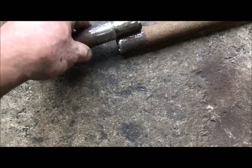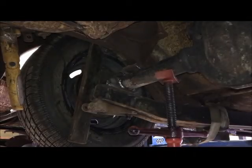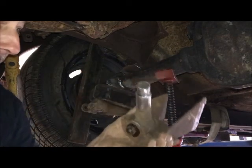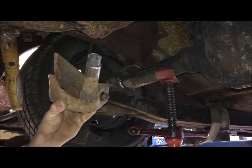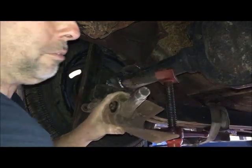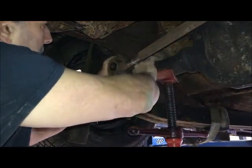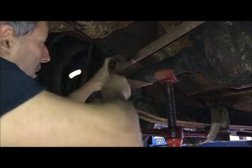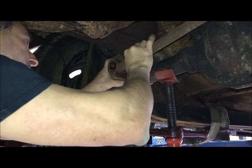So we'll get that welded and then go back to checking on the mount position again. For the Panhard, couldn't weld it on the floor because I forgot that there's the angles in the pipe and I didn't mark them before I just chopped it. So easy enough to take care of, not a problem. So just put this together, bolt it together in its mount. Swing this up, put the sleeve together, put it where it wants to be. I'll give myself a little gap in the slug there and get everything straight.